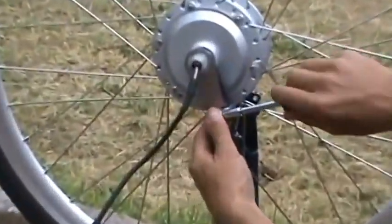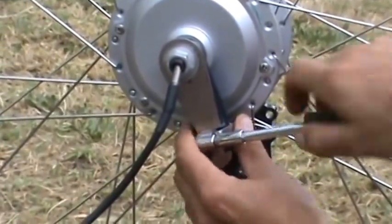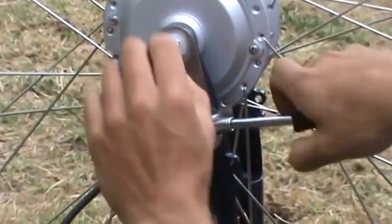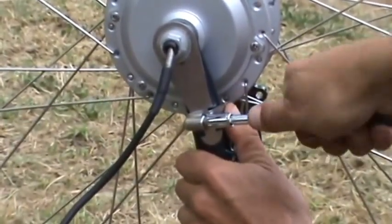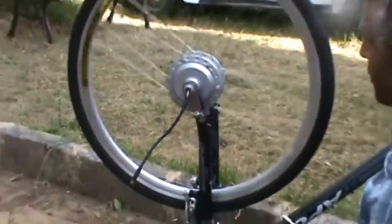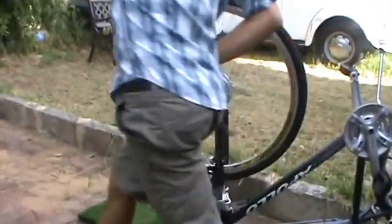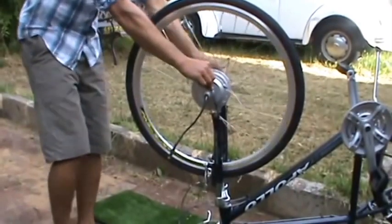There's a bunch of different design torque bars. If the one you have doesn't suit, let me know or have a look on the internet — you can find different designs. Some have different size motors if you've got a motor from a different source. That's quite nice and tight, and that motor's not going anywhere now. It's very safe within the forks, nice and centered in the middle. You have one washer on either side, the one with the lug on the inside.